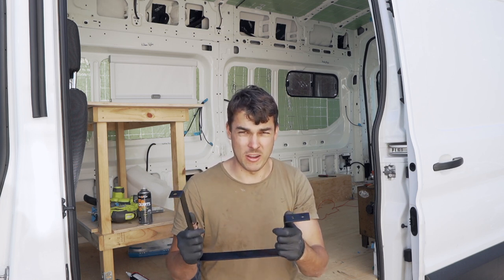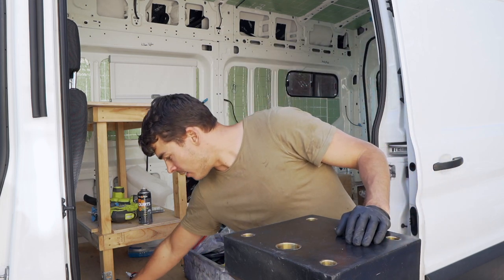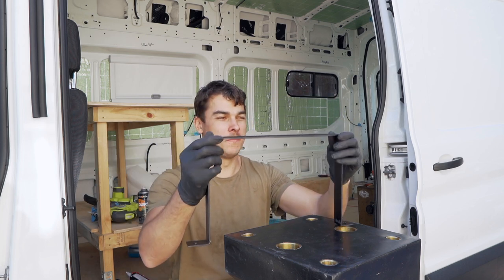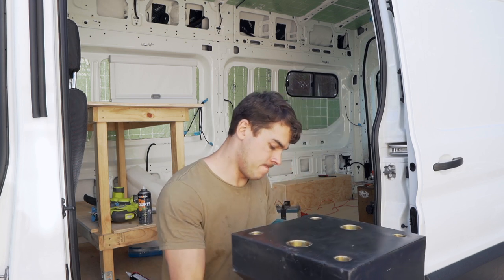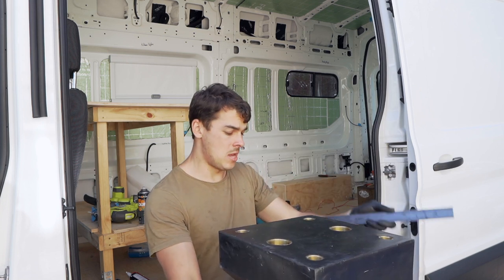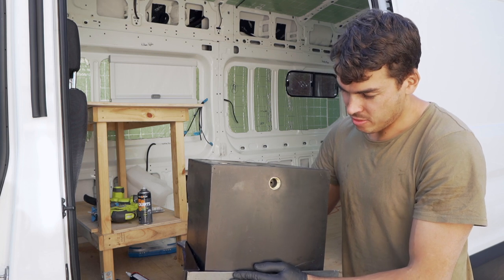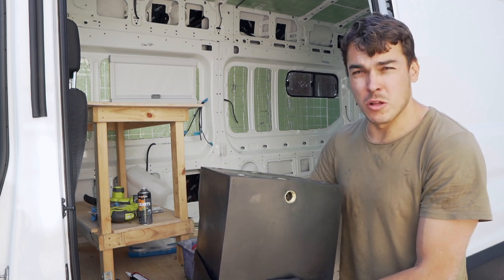It's pretty hard to get brackets a hundred percent when you're just bashing it with a hammer. The other bracket for the freshwater tank is more of a two-part bracket. You get the first part with five holes drilled in it that bolts directly to the van with tech screws across three areas. Then a flat piece sandwiches on top, held together with two bolts. The reason for this design is if I need to drop the water tank for any reason, I only have to undo six bolts and the whole thing drops.